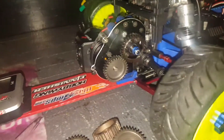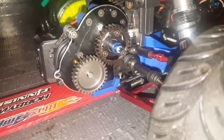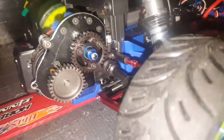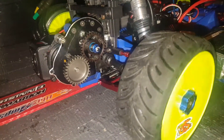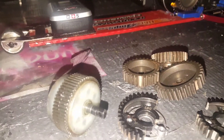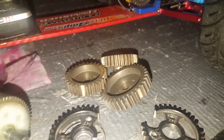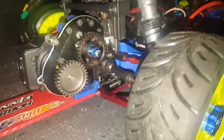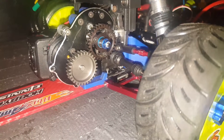I did it for my partner on his Rustler, and I'm gonna do it on mine too. I'm gonna go ahead and put positive traction to both of my wheels. You notice how when you pick the car up and roll one wheel, the other one goes the opposite direction? They did that for a reason, but I want to put positive traction for both wheels. So I'm gonna lock that orbital gear up with some JB Weld. You don't have to super fill it up — just cover the gears so they're all covered up, then put the cap back on, tighten it down, and wait a few hours to make sure it cures up real good.